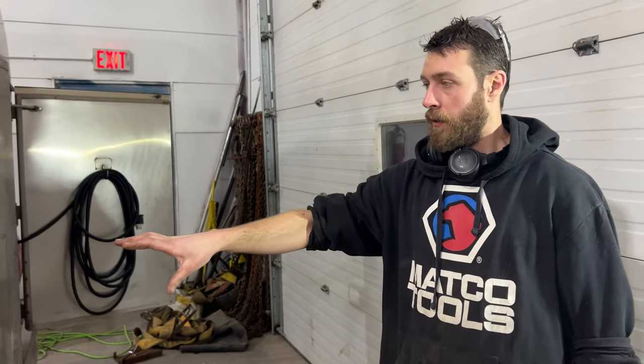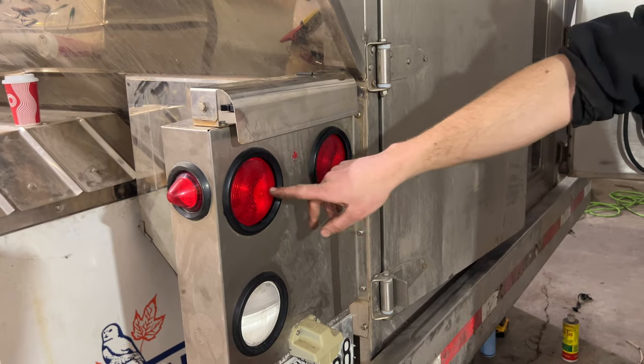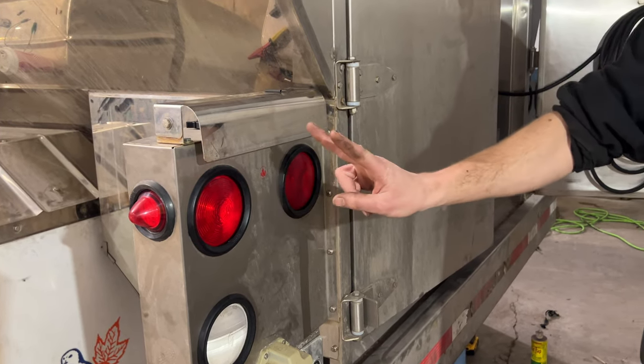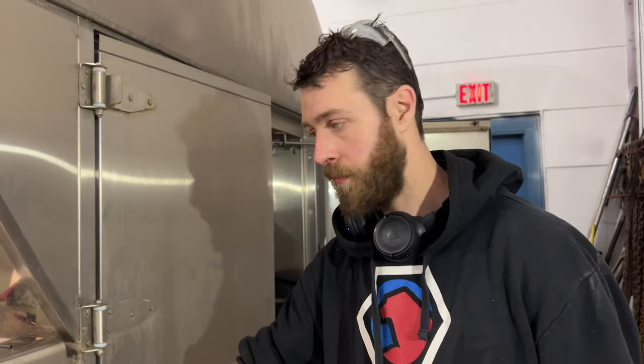The issue was the way they had it wired up, I could only get turn signals and tail lights. These are LEDs and they have two inputs and a ground. With the tail lights there's a resistor in line so it's a lower brightness, and then with the turn signals it's full brightness.